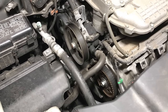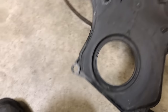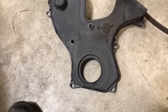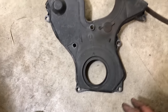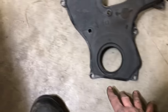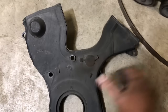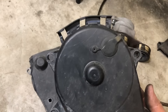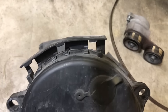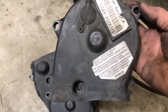I'm going to keep taking the 10mm bolts off the timing belt covers and show you the failed tensioner. Here are the timing belt covers. Just to give you guys an idea of how many bolts need to come off: the bottom one comes off last because the top two kind of hold it in place — it has seven bolts. On the back one against the engine firewall, you've got five bolts, three on the bottom and two on the top, and a little wire harness that goes across the top. And then you have another five on the front cover.